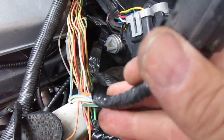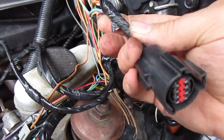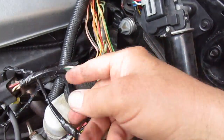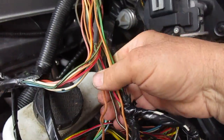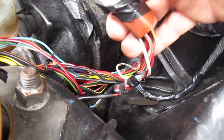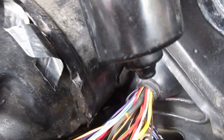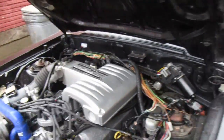I'm going to trace every one of these down, see where it goes. If it goes to the ECU — the computer or wherever — I'm going to remove them. So I'm going to have a lot less wires here to put a wire loom on. All these others are going under the fender well — you see they're coming through here. I'm getting less and less wires coming through the grommet, and I'm going to sneak them down through this hole and go under the fender well.